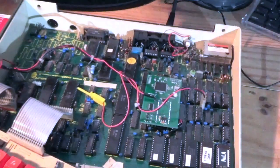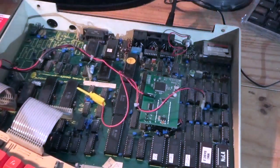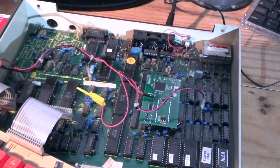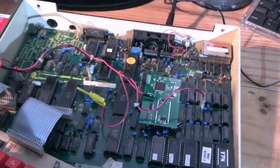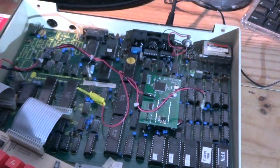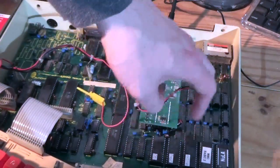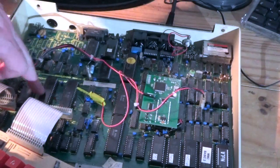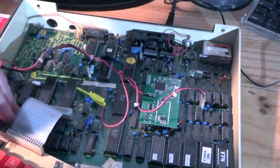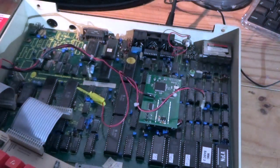If you do have a machine with an Intel floppy controller and either version 0.90 or 1.20 of the DFS ROM, unfortunately this is not going to work with a GoTek controller, and it won't work with any modern 3.5 inch floppy drives either. We'll still power this up with the GoTek and we'll get so far — we can catalog directories — but we can't actually run any software without needing to upgrade. The upgrade is a replacement chip, and it also has to replace the floppy controller, plus two chips under here which also need changing out, and you can buy kits to do this.